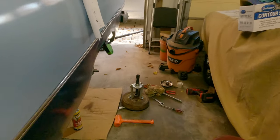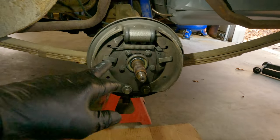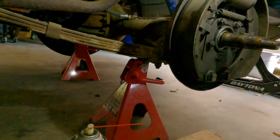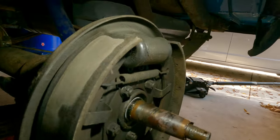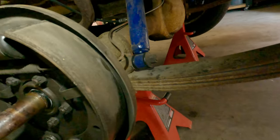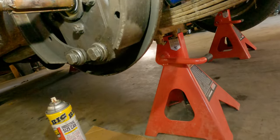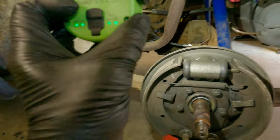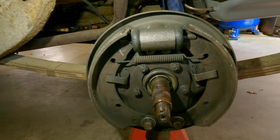Here we are on this one again - I had to get this thing out again. This one actually has cam adjustments at the top for the toe. Of course, the big ones do the heel. The heel is getting contact, needs a little more here, and quite a bit more up here. These suckers probably have asbestos in them, so I'm going to spare you guys fooling with this stuff. This one's even more of a pain because you just can't slide the drum on and off.